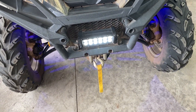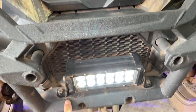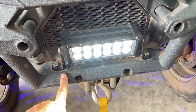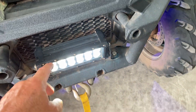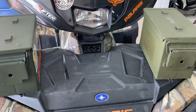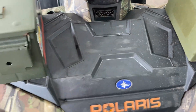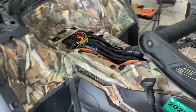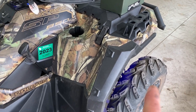This one here is the LED light bar — turn that on. Here's a tip: if you're going to get an LED bar and you've got a front bumper as an accessory, I highly recommend you put it there because you actually need to aim it down a little bit. A lot of guys put a huge 24-inch light bar up on top — don't do it. And you don't need a 24-incher; that 8-inch is more than enough.